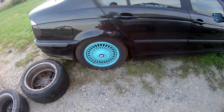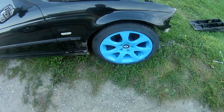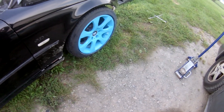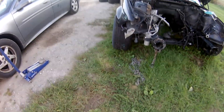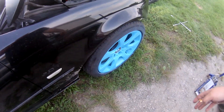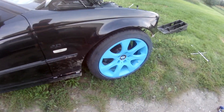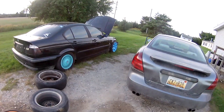We'll put them on the car and see what they look like. I'm actually really impressed — the offset is literally perfect. The only thing that is not perfect is it's not going to fit the rear, not at all. I'm going to have to raise the rear. I'll try it, but I don't really think it's going to work. That looks freaking good. I don't know if you can tell the camber on there, but with a 30 millimeter spacer, with the engine in there it'll probably go down maybe an inch — so it's literally perfect fitment for me. Looks way better.